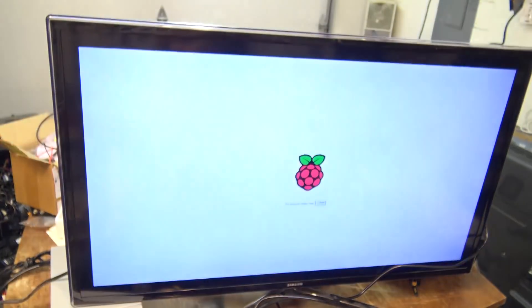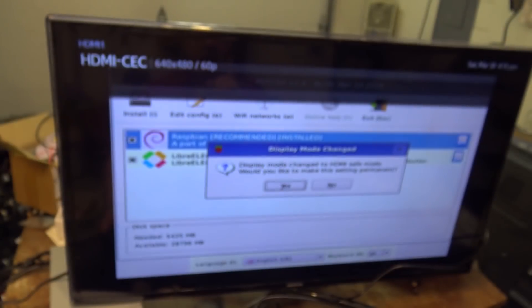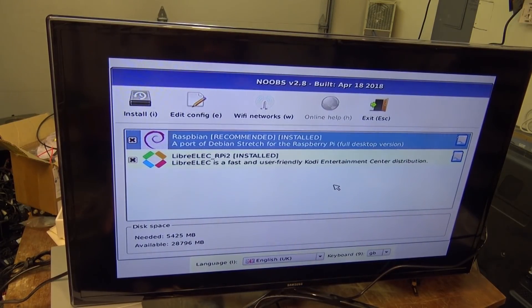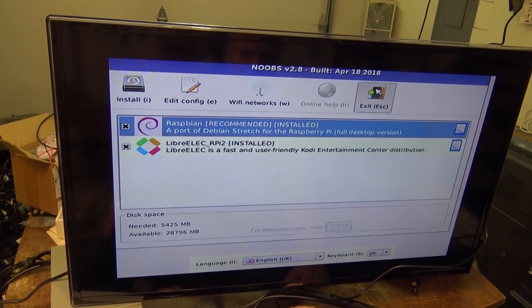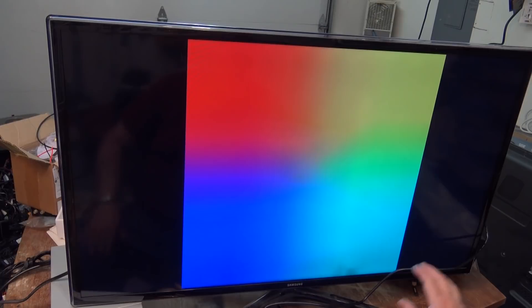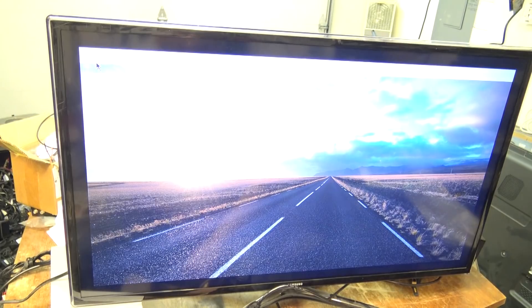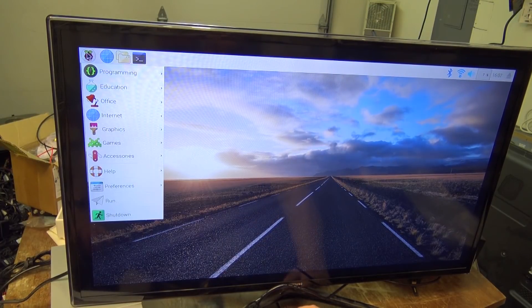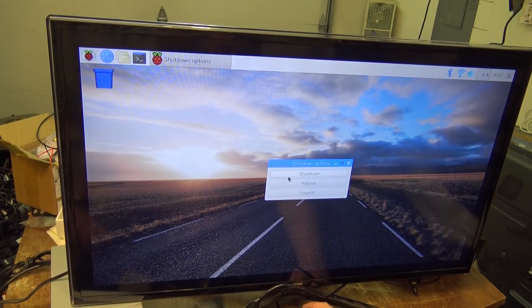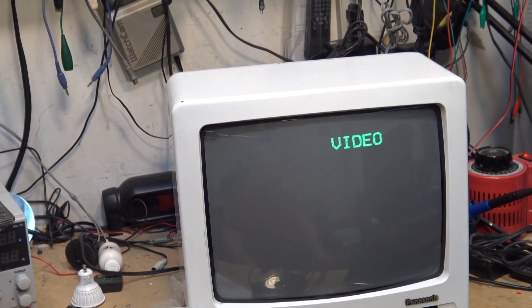Here's another option: if you hold down the shift key when the system is booting after 15 seconds, you can hit the number 2 key to select HDMI safe mode. Make this a permanent setting. Now watch what happens — I exit and shut it down, unplug my HDMI monitor, turn the power on, and it will now boot up in standard definition through the composite output. In HDMI safe mode, the resolution is determined by whether you're connected to HDMI or not. There's the Raspberry Pi desktop — it went straight into Raspbian without the selection menu.